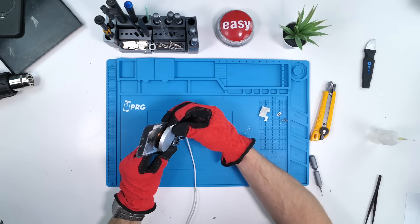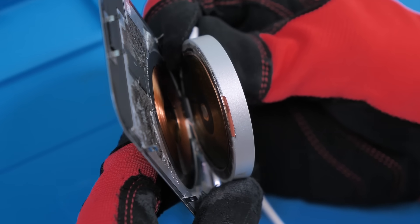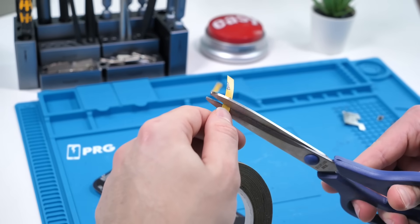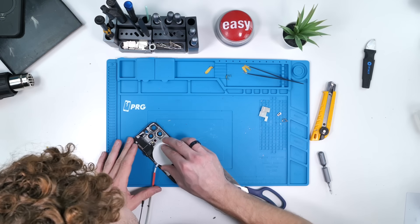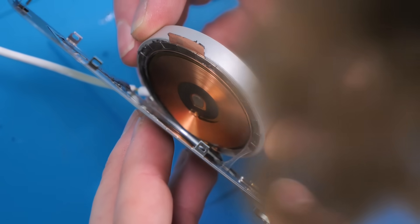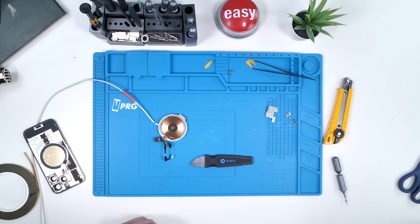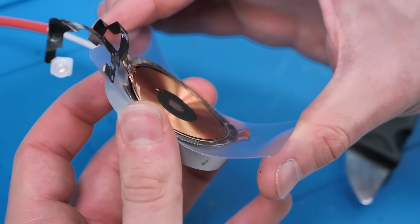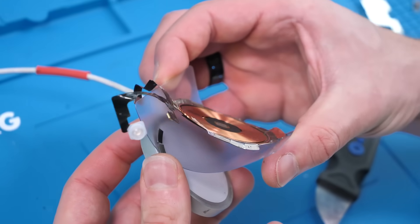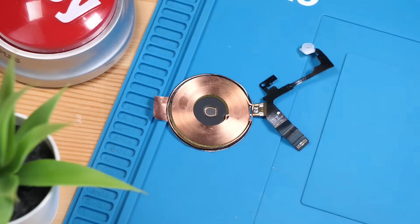We've run into a bit of a predicament. The cover of the wireless charging coil seems to have come off — they're supposed to come off together but they separated. So we're going to add some adhesive on the coil, re-adhere it to the back, and then try to pull it off that way. And that actually worked! Now I made a bit of a mistake — usually I put paper behind the coil but this time I didn't. Let's see if we can fit a card under. It's not looking amazing right now so we'll clean it up and replace the magnets later on.